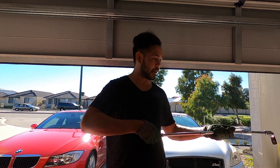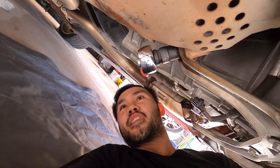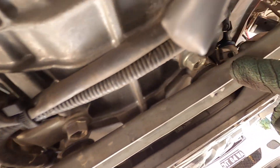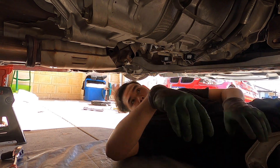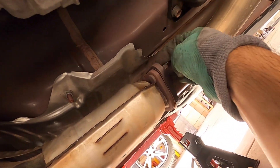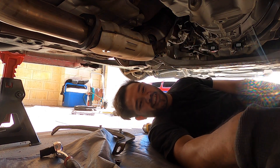Today's goal has been accomplished. I added another medium-sized extension just to get that clearance. I need to get back under the car and get the brace off and the rest of the nuts and bolts. Back under the car - I already broke these loose. Now it's time for this brace here that holds the cats and the transmission. All this is open, so let's take off all the Y-pipe bolts and then try to wiggle these cats out.